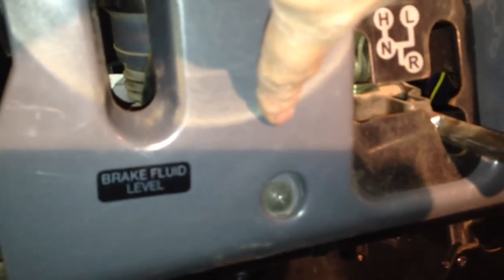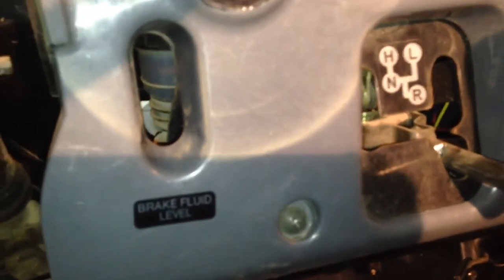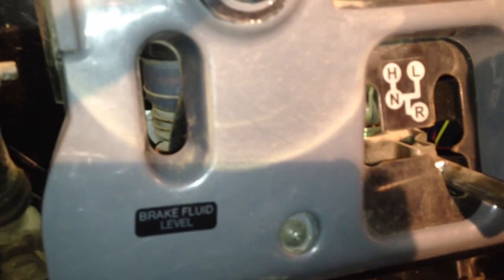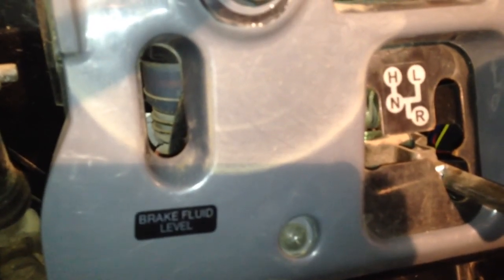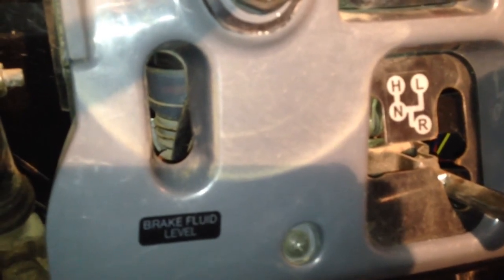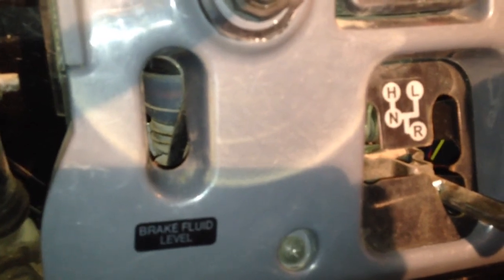I think I'm going to go right here above this screw. I have to go over a little bit because there's two bolts behind it. And there's a metal plate that runs the length of the dashboard too. So hopefully my hole saw is up to the task of cutting through this. Plastic, not worried about. The plate steel, I think it's only like an 1/8 thick, maybe less. Hopefully it'll go right through. I've already dug around behind the dash to make sure I'm not going to cut any wires or cables or anything, so this ought to be fun. Yeehaw!